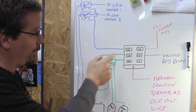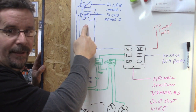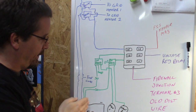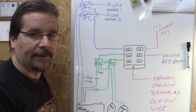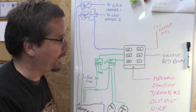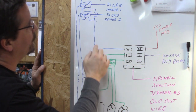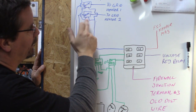I put a 15-amp fuse in the first hole. It goes up and feeds the relays for the grid heaters. I actually used the relays, cables, and harness — everything from our 95 Dodge donor truck. If you haven't seen the video on the donor truck, I'll toss the link up here. By having the donor truck, I was able to use stuff like that — it saved me quite a bit of time and money. The 15-amp fuse is going to the lower current positive side of the relays.